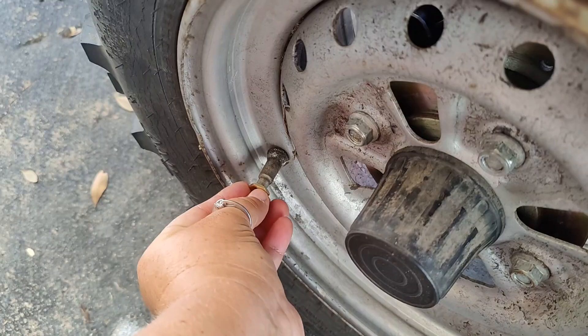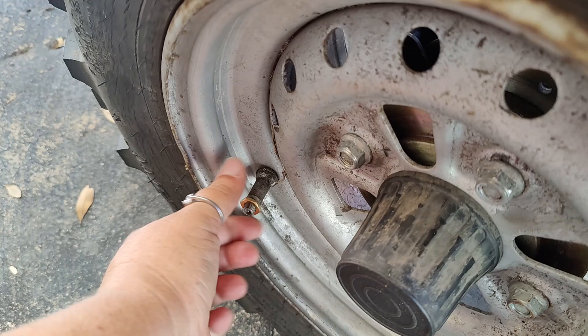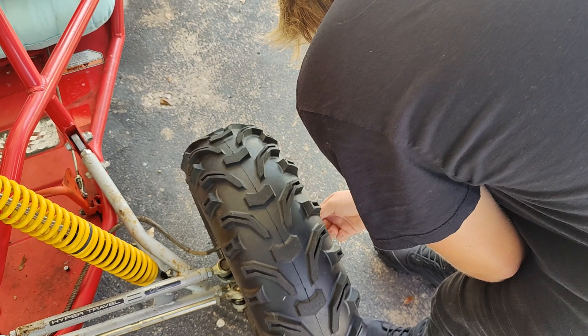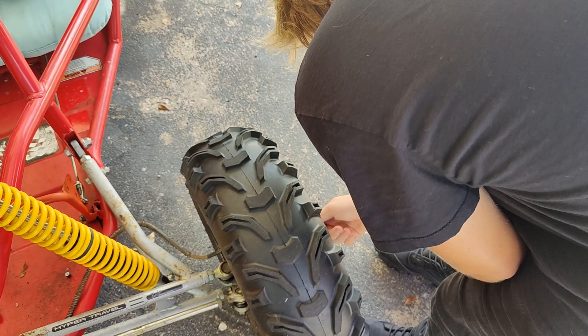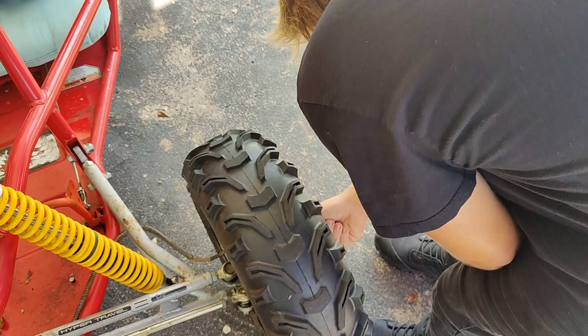To install these on the tire you're going to first screw one of these brass fittings onto each of the four tire stems, then screw on your tire pressure sensors. You will hear a hiss — this is normal. If it continues hissing you may need to adjust that brass fitting that we installed first, because it should only hiss one time and not continuously.